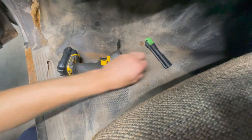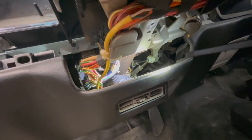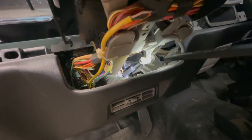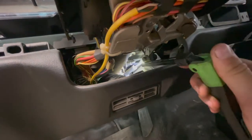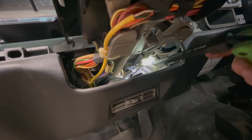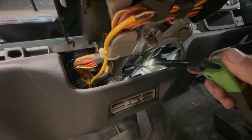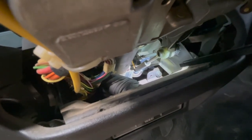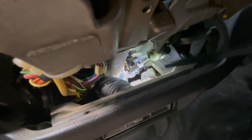There it is. Let's remove the bezel. The lower part of the bezel is removed - that's all we have to do. What we're looking at right here - I'll point to it with the light - that is the shifter cable. What we have to do is remove this piece from this lever of the column. You get a little pry bar or screwdriver in there and pry that off. If you look further down, that metal sleeve is holding the rest of the cable in place. After we remove this and pop it off, we pop out that bottom sleeve and can remove the cable from the shifter column.